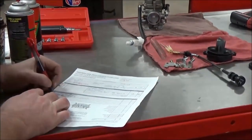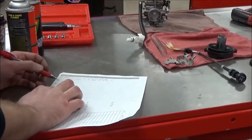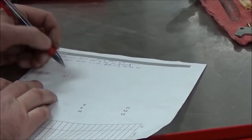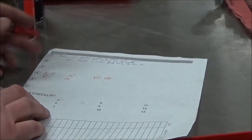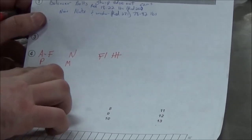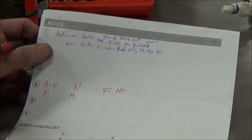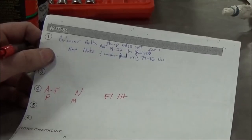I'll create a line item here — line number four — for the carburetor. When doing work orders, I make a little chart: air/fuel screw setting, pilot jet or slow jet, needle clip position or stock, main jet size, and float height. I always measure where float height was versus where it should be, because that can address complaints like bad gas mileage or the bike running hot.